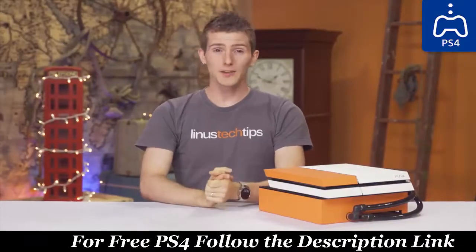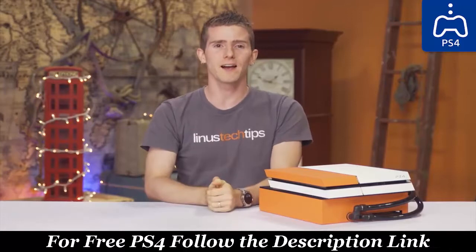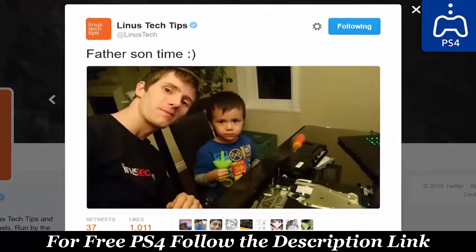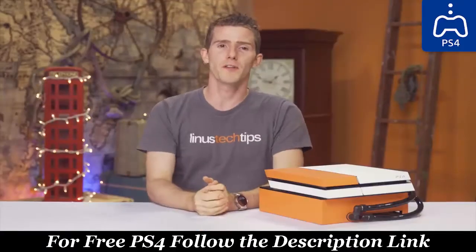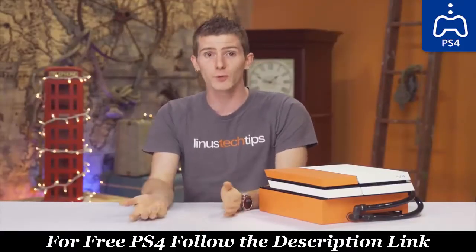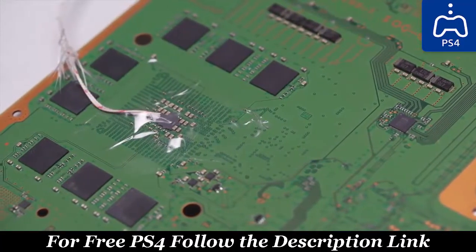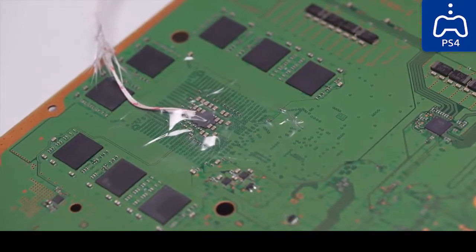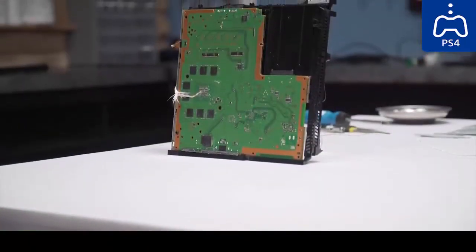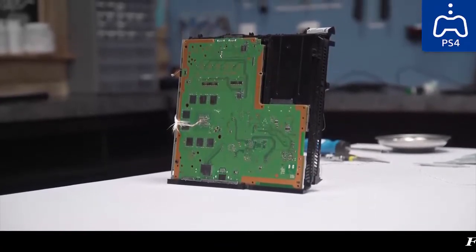This journey began over six months ago when my son and I sat down and tore down the PS4 looking for the best way to tackle this problem. Then I got busy with other projects and handed it off to Jake, who promptly did what any sane person would do and taped the thermal probe using a non-conductive thermal paste to the back of the main board and reassembled it. He chose this position because placing the thermal probe on the APU directly would have affected the contact between the heat sink and the APU itself.